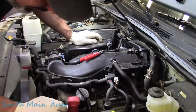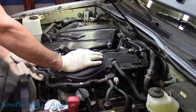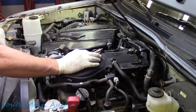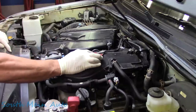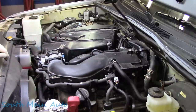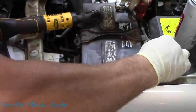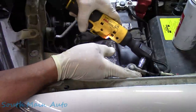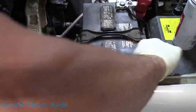We still got to put the fender liner back in. I'll just double check stuff here. All the clamps are tight, all the brackets. Tighten that lower bracket too. The new air filter, all the nuts and bolts over there. And with a little bit of luck, we got the wiring right on our cam sensor and it should even run, hopefully. So put a little fluid film on that. Hook that up, the battery's been unhooked the whole time here. That's all snug.